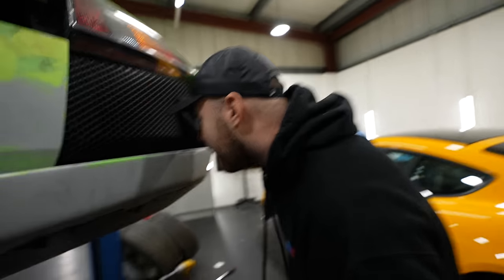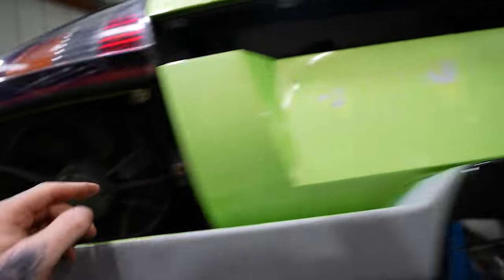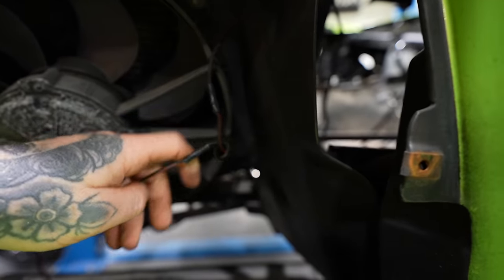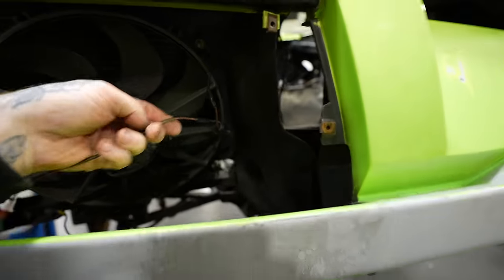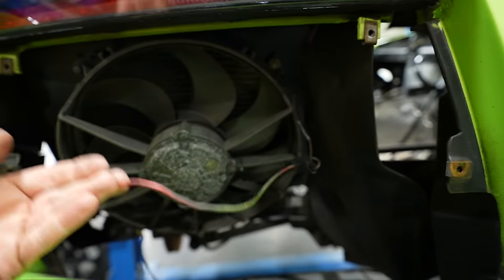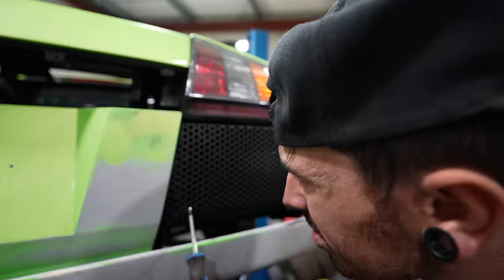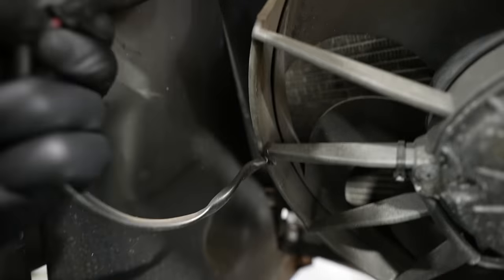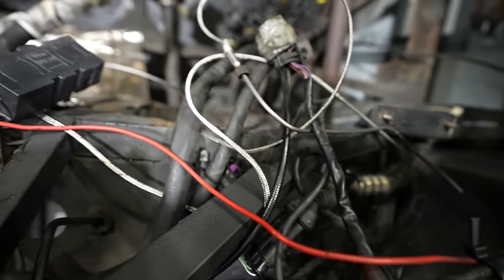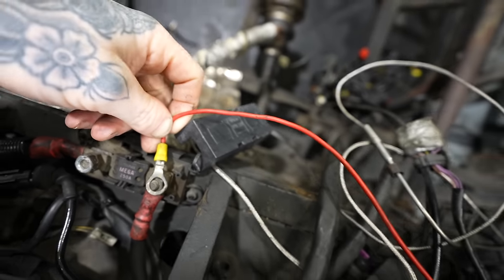There's actually another fan as well. One of the fans goes to an actual plug as normal, so that one works. But the fan on the left-hand side of the engine has its positive wire wired straight to a live feed, meaning the fan would be constantly on. It could have been an accident that ripped the wires and they refixed it, or the ECU is fried and they've added a manual fan switch — though I haven't even found where that switch is.